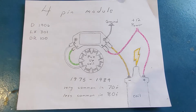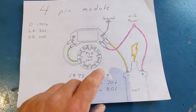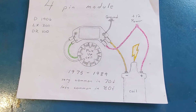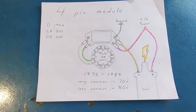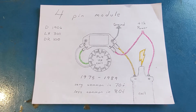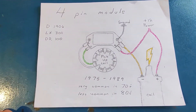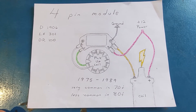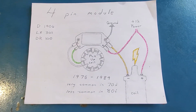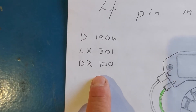Here's the wiring diagram for your common four-pin ignition module — pretty simple. I've got the ignition coil externally located in this diagram to show that this module is very useful not just in original GM distributors, but it can also be used with many other kinds of distributors. Any kind of distributor that basically has a magnetic pickup coil — this module can be used. It can be used in a Ford, a Dodge, a Toyota, any kind of import, lawnmowers and boats, anything with a distributor and a magnetic pickup coil. And here are some quick part numbers in case you want to find one at an auto parts store.